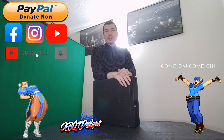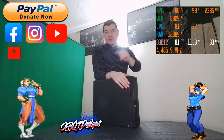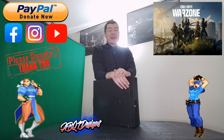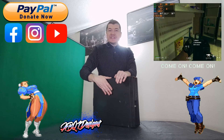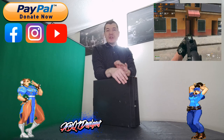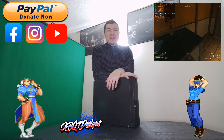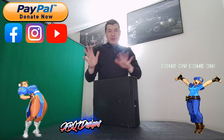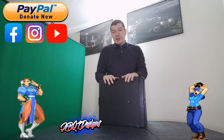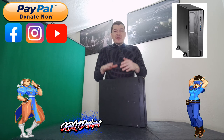Now that we've taken a look at the FPS and temperatures, the two games we tested were Fortnite and Warzone Modern Warfare 3. You could definitely see in the gameplay footage that the case got extremely hot. The graphics card was hitting between 85 and almost 90 degrees. Based on that, I definitely would not recommend putting a 4060 in a solid case like this. In fact, putting it in any small form factor case without proper ventilation is a bad idea.